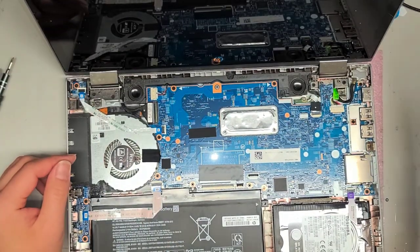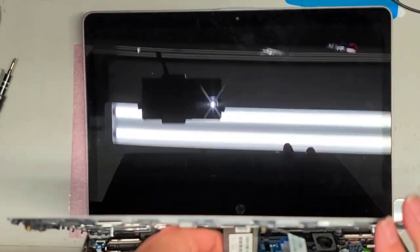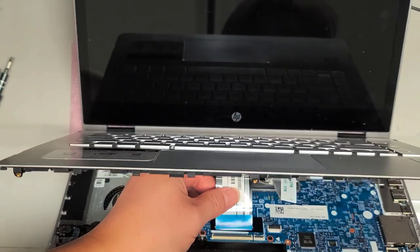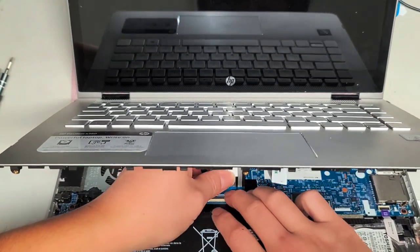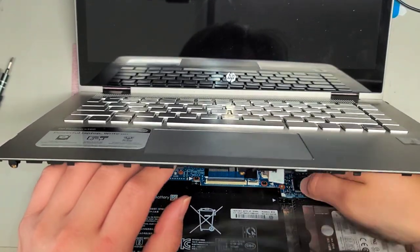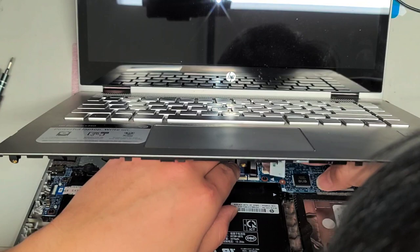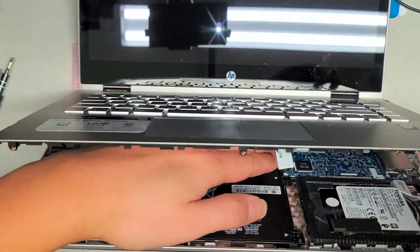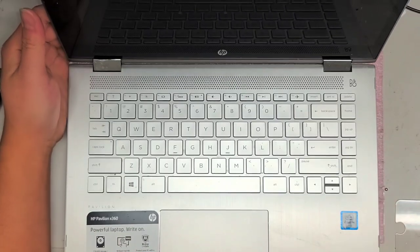The way you want to carry your computer is from this side. If you put it in a bag, get a big book or something so when it pushes on it, it pushes on the whole thing, not just a small area. Now the kind of difficult part: we've got to put back the keyboard, the trackpad, and all this stuff. Tilt it forward like this, make sure the latches are up. Basically you just plug them back in and then put the latch back down. Get that cable back in, push the latch back down. Same thing with this cable — get it back in, put the latch back down. Trackpad — same thing, cable back in and then put the latch back down.